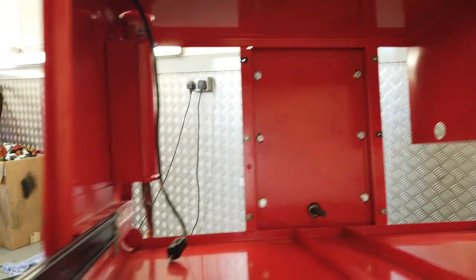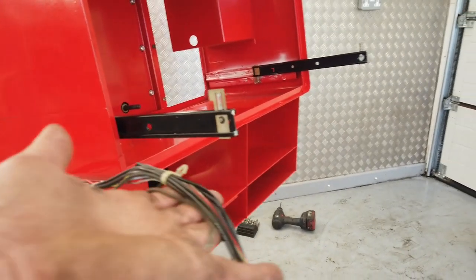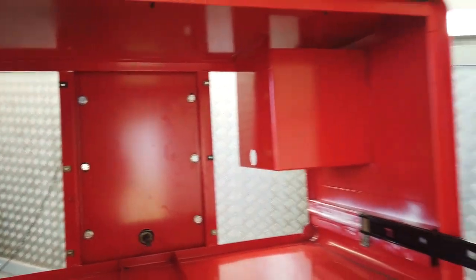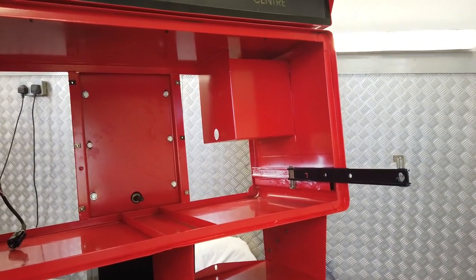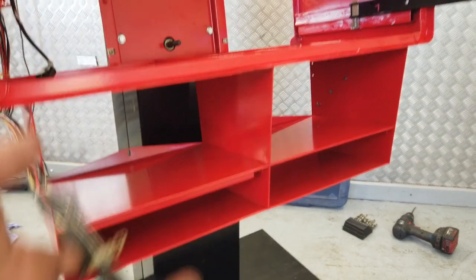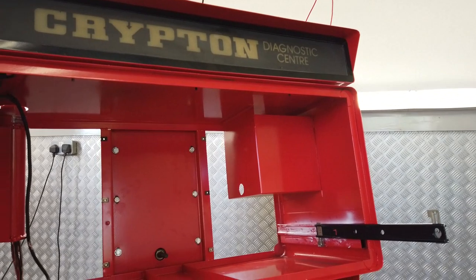It might be easier to connect the earth harness up now. There's earth harnesses here, so perhaps we'll install the harness. It'll be easier to get to the earthing bolts right away. One of them connects to the earthing tag down there, and the other one goes up to the cabinet, I believe, linking them together. Makes sense, because you've got to earth your cabinet. So this one goes up and earths the cabinet itself on the P-clip bolt, I think. I shall refer to photographs for that.